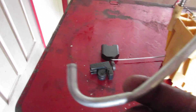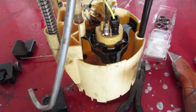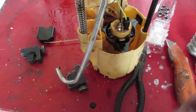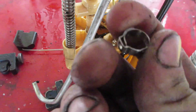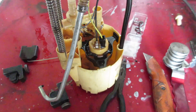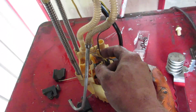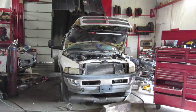Basically just want to put a little bit of a corner on it so it only sucks from about the bottom half inch up. That way you don't get any dirt in there — with a sock on it if you want, not a big deal, the filter will catch everything. Use some of these little clamps to tighten the hose onto the pipe. These are nice because you just squeeze them together and it makes a full seal — not like a hose clamp where you get a flat spot. Stick that in the bottom, clean the bottom, and figure out your two wires that run the pump: your black and your yellow. Then run that to the pump that is now under the engine.